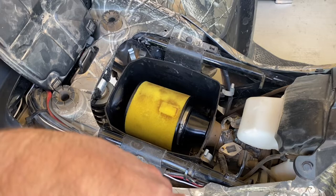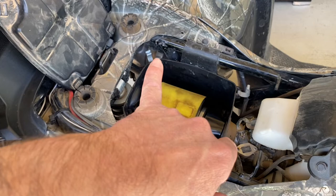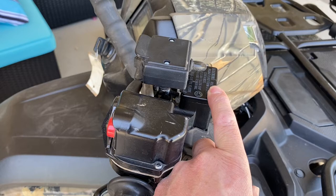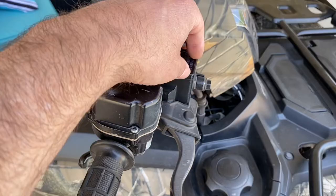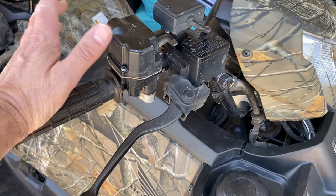I haven't blown out the exhaust before — probably something I should look into. I do know that my cousin never did her brake fluid for about 10 years and it gunked up, requiring a full master cylinder replacement — still only about $30, but avoidable. It's so easy to just open this up, use paper towels to soak up the old fluid, open the bleeders, let it run out, put new fluid in, and bleed it by pumping. Probably takes 20-30 minutes. The manual says to do it every two to three years, so I'll probably do that soon.